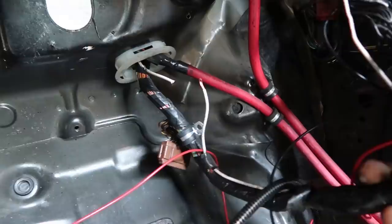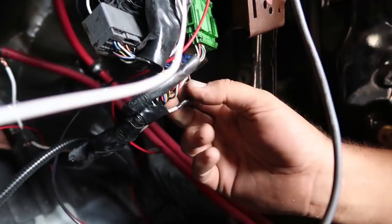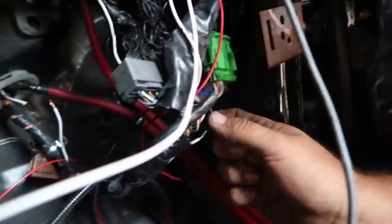There's a cut wire right there - what's that going to? It comes up here to a red with green stripe, so that'd be like the MAP sensor. Let me see what they've got going on. I'll plug in too and make sure we're reading a MAP sensor - that could be why it stalls and runs weird.